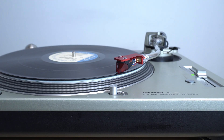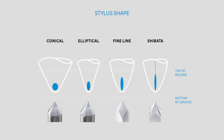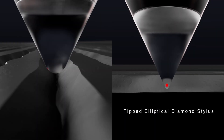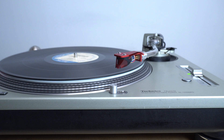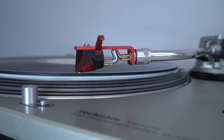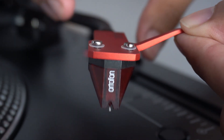The 2M red is one of the top selling entry-level hi-fi cartridges. The stylus features a bonded diamond tip attached to a metal shank. The shape of the diamond is elliptical, which is an upgrade over the conical styli that are featured on most entry-level cartridges. The elliptical stylus will pick up more fidelity from the record and lead to less record wear. The 2M red has an aluminum cantilever, and the tip is glued to a shank that's then attached to this cantilever.